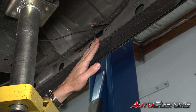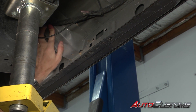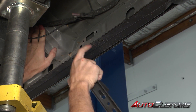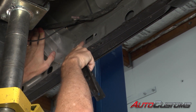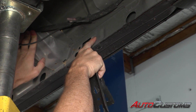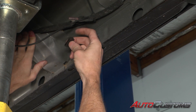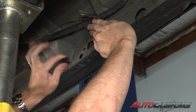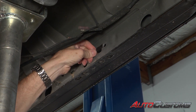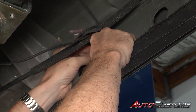We're going to go to the front portion of your rocker panel. If you're on the driver's side, we're going to move the brake cable out of the way. We're going to locate the bracket — there's a hole in the pinch weld and a hole up in the rocker panel next to this rectangular hole. This whole area might be covered up with tape, so you might have to peel it away to find that. We're going to take one of these clip nuts or U-nuts and slide it through this rectangular hole and center it over top of the round hole. That puts threads behind the rocker panel.